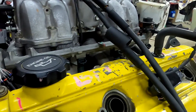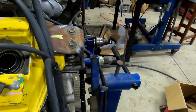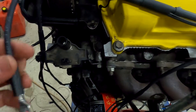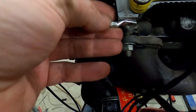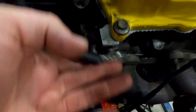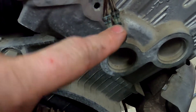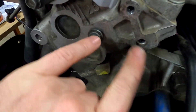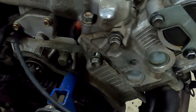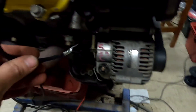I've had my loom off and I've actually been across testing it on the vehicle. Normally I'd put the earths at the back of the engine on the factory spot, but this vehicle was a bit tight, so there's actually a couple of really nice earthing points right at the front on each side of the cylinder head. Factory on 1UZ they're on the back of the cylinder heads — and yes, I did just swap to a VVTi. These holes are the earth holes, and since this is really close to the firewall, onto the front of the cylinder heads makes a lot more sense.